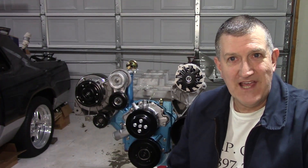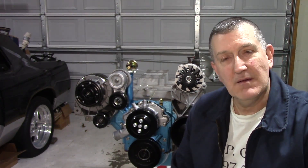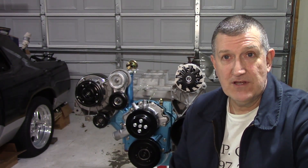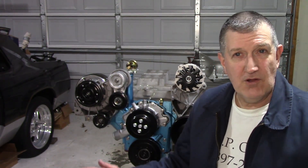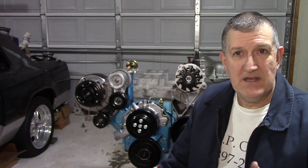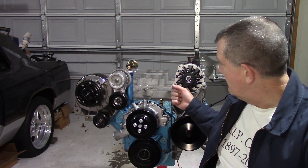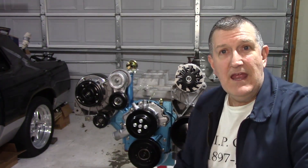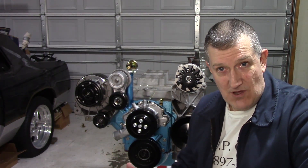It's a short video, I know, but I was so excited to get that part in the mail. Anyway, Pacific G-Body — friends of the channel — you should check them out, there's a link right down there. They sell a kit for big block and a kit for small block. The small block says they're sold out, but they make them on demand when orders come in, so you could shoot them an email. It's got all the parts and hardware — everything to do it. All you need is your GM brackets, accessories, and a Ford pulley. It's ready to paint, so I'm just going to throw some paint on it, get some longer bolts, and that'll go back on.